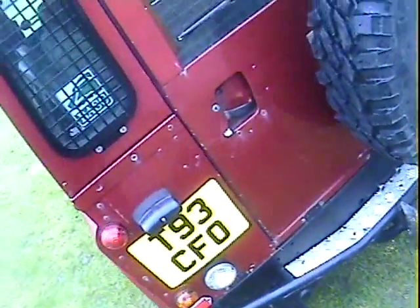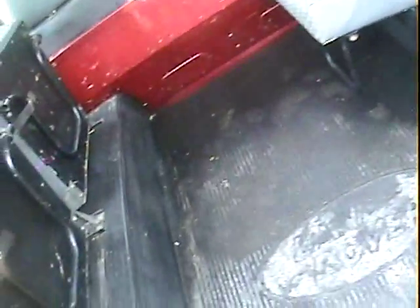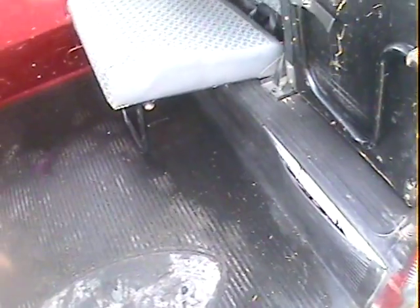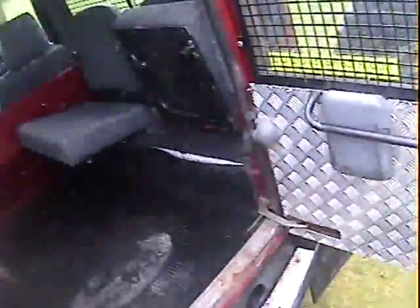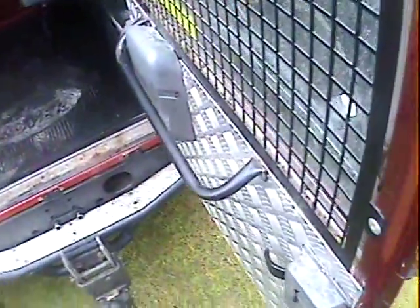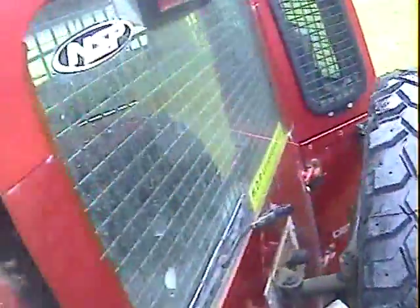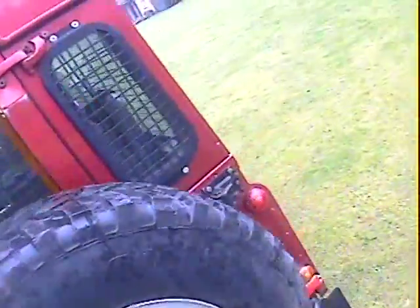Looks nice and correct underneath. Around the tail end there's the usual reaction on the tailgate around the handle and down the bottom. There's a spare wheel carrier fitted, which I forgot to mention. In the back, the matting has been replaced with carpet that's just coming away slightly and needs sticking back down. Four individual rear seats with seatbelts, checker plate door card. The tailgate is rusting around the latch and quite severely down the bottom, but it doesn't affect the integrity. Down here it all feels pretty good, and the spare wheel carrier is taking the weight of the spare wheel off the door.